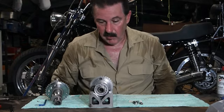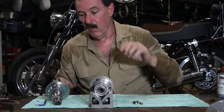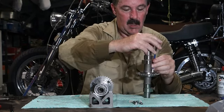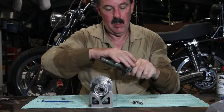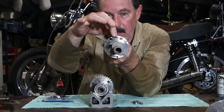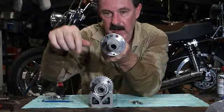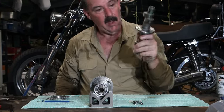So I thought, since I've got it apart and sitting in V-blocks, might as well balance it. So what I did was, I'll have to take this apart, I think, for you to see it. So what I did was, I drilled these 3 holes on the heavy side, and each time I drilled one, I put it all back together, put it in the V-blocks, spin it, find that I needed a second one, did that again, found that I needed a third one, so I did that again, and that is very, very near perfect. So I'll put that together and run it for you.